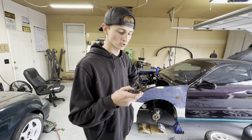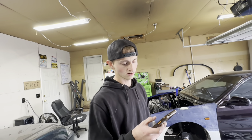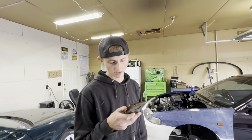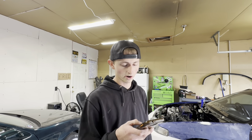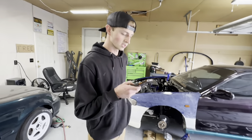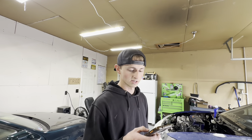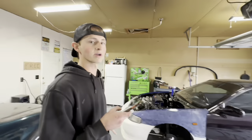These are twin blocks — there's twin blocks and there's monoblocks. The twin blocks are a little bit smaller and the monoblocks are a lot larger. The twin blocks are for an EK9 or DC2R with a 282mm rotor. The monoblocks are for the ZF1, S2000, TSX, CL7 with a 300mm rotor — and the monoblock also fits EK9 and DC2 Type-R but requires a 300mm rotor. For spindles, you need an EX-SI, CTR, ITR, or GSR knuckle. EX-SI or GSR spindle needs a 10-inch rotor; CTR or ITR, you reuse the 11-inch rotor, which is what we have here.